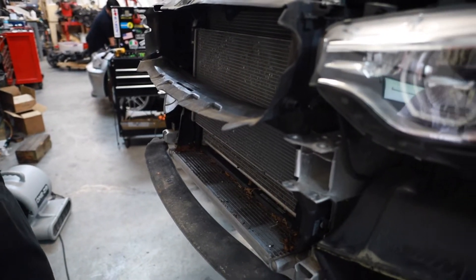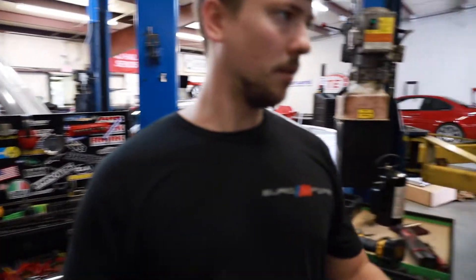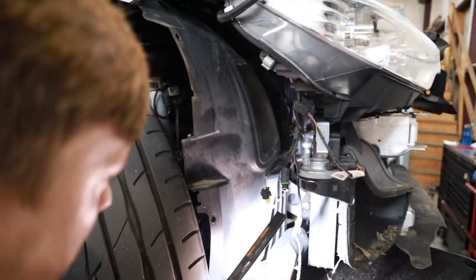That's why these things can go to the track and do lap after lap. Your auxiliary heat exchanger right here tees in right there to the main heat exchanger in the front, so we're going to drain it right here — this is the lowest point.